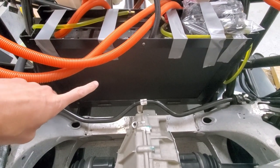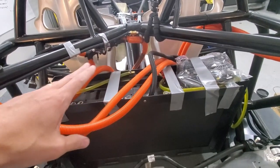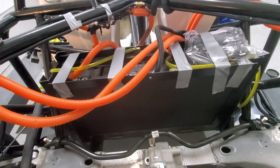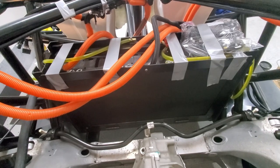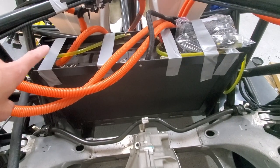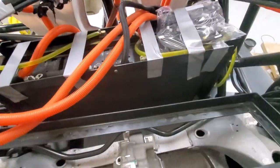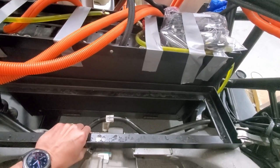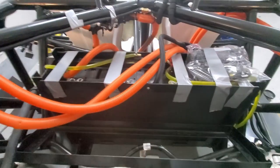For this back battery box, I had a hinged door that could open because you can't really take these straight up — there are bars in the way. I'm planning to put the two other batteries right here and here, so I've got to get rid of this door. The door doesn't hold the batteries; they're held by a bar across that pinches them tight. This will be the battery tray. I've got to make some brackets to fix it to the frame — one battery module there and one there.